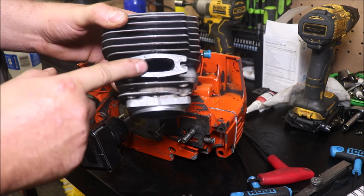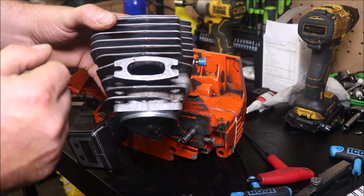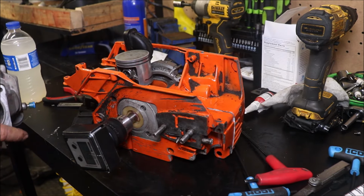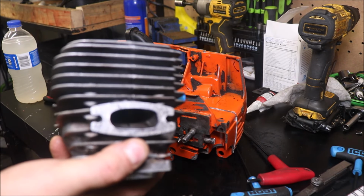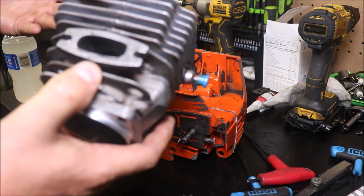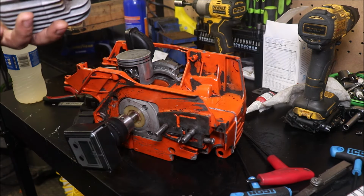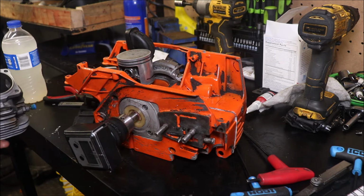We're going to go into the exhaust port. The port will be widened slightly. Going to clean everything up, lay a really, really good polish on it, and just kind of leave it where it falls. We could go in and raise it, move the RPM band on up, but I do not really want to give up any of the static compression that we have gained, or cranking compression, however you want to say it, from lowering the cylinder what bit we did by pulling the base gasket and doing the machine work.